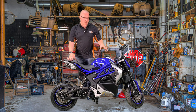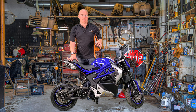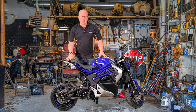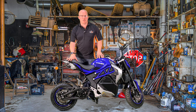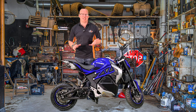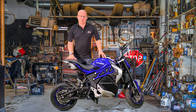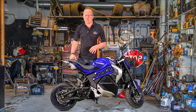On an electric bike, they set it up with loads of sensors, do a half-hour ride, and work out with the speed restriction what power output is required to maintain that speed for that amount of time. On bikes like the Zero, their running output is 11.5 kilowatts but their peak output is the equivalent of 59 horsepower — loads of torque, loads of power. This one is a 50cc equivalent and it has 14.4 newton metres of torque, compared to about 10 newton metres on a standard 125.